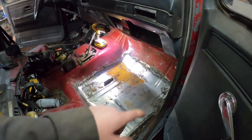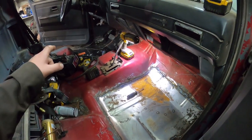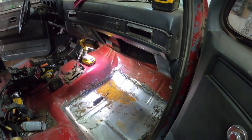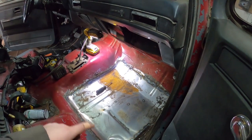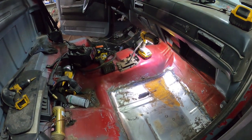So I'll just zip it out and plug it in real quick. I'm gonna grind this all out, vacuum everything up, and I'm just gonna seam seal it, call it a night. And then tomorrow I can be back at her - once the seam sealer's dry, then I can paint it, because I want to paint it all black. Two, two nights, three nights - yeah, the first night I was cutting everything out, the second night I welded all that in.